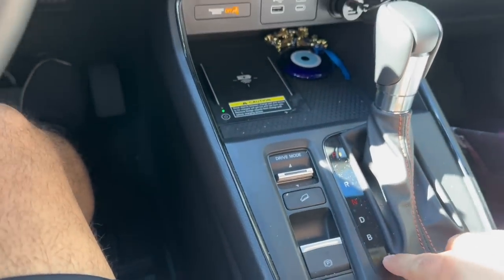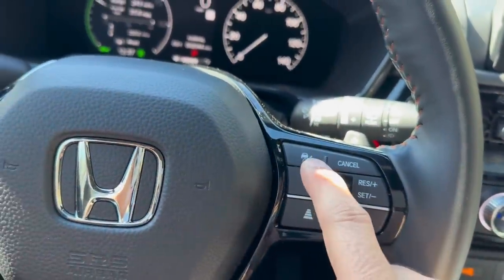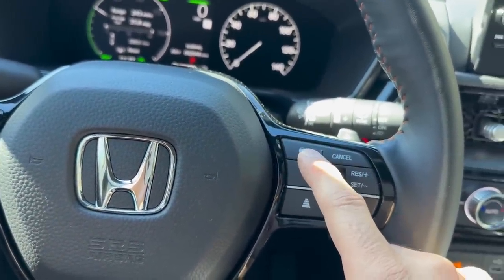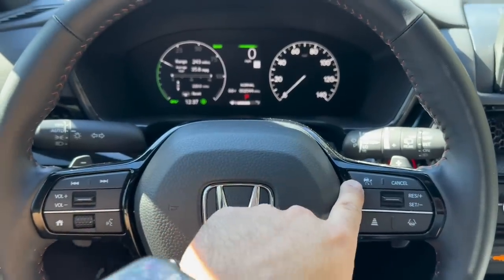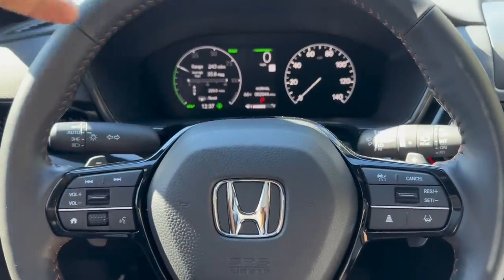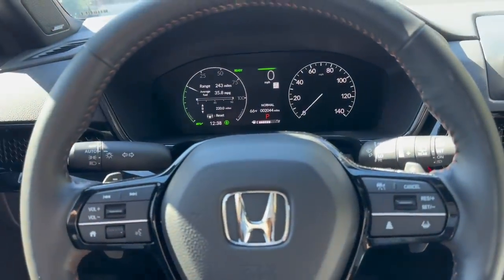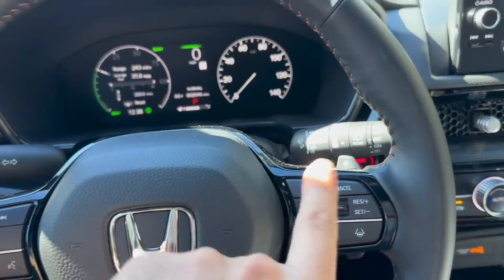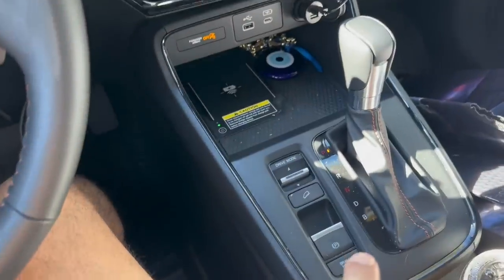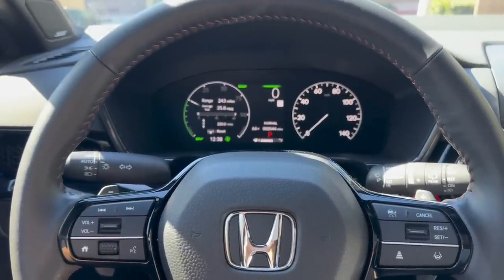Another feature about regenerative braking: it does not allow cruise control when you have it set to B. You have to set it to D to use the adaptive cruise control. That does not mean you don't get regenerative braking — I think you just have to shift it to D so the car's computer can handle everything on its own. Once you turn it on, it uses that radar to gauge the cars in front of you and speed up and slow down. It works very, very well. I rarely touch the gas or brake when driving on the freeway — it does the whole thing for you. You will still see that green bar increase and decrease, so you're still getting regenerative braking when you have adaptive cruise control on, even though you're not in regen braking mode.